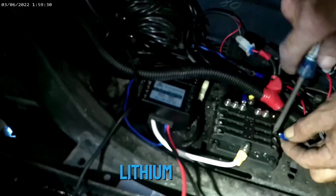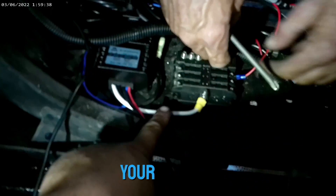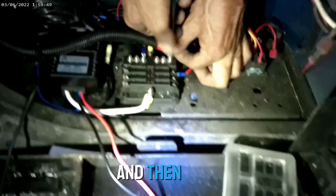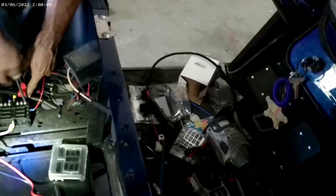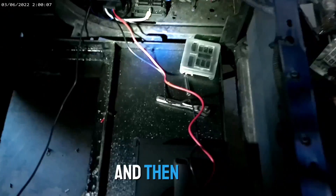So right now we're wiring up the accessories. We've got the lithium Rhino DC converter in there; we're adding a fuse block. So the black and the white off the converter — your white is your positive to the fuse block, your black is the negative. Then you have a black and a red here; these are going to be our power wires. We've got to extend these; they're going to come over to the battery. And then your blue wire is a key switch wire — you're going to have to run a wire off of that one up to the non-hot side of the key switch so it turns like a burner on and off. So we're going to finish wiring up all these accessories and clean up this wiring.